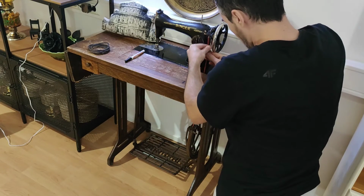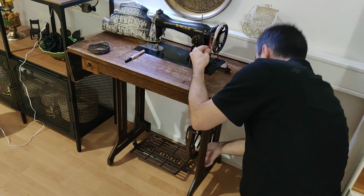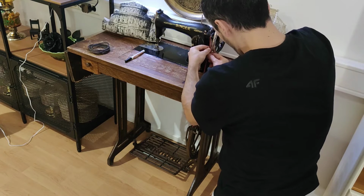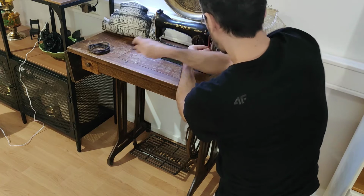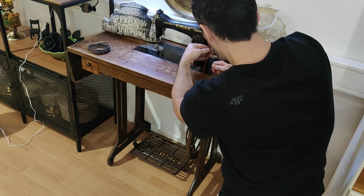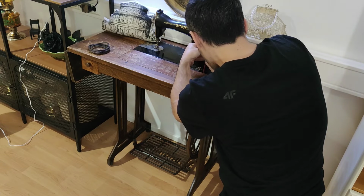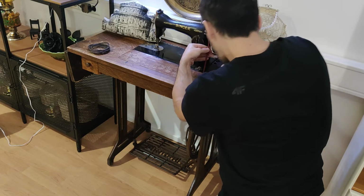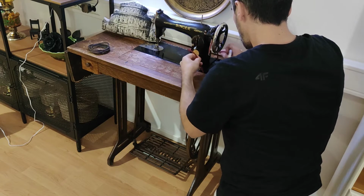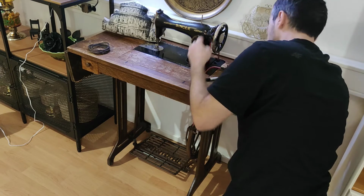Be sure that you have good tension on the belt. It doesn't have to be too tight, but it is also not good if it's too loose. Then mark the cutting position and the hole with a marker. You can also first pierce a hole if you are not sure if the belt has good tension, but I decided to cut it right away.